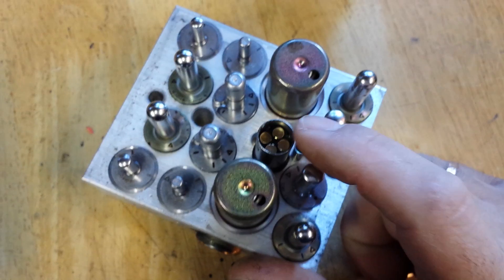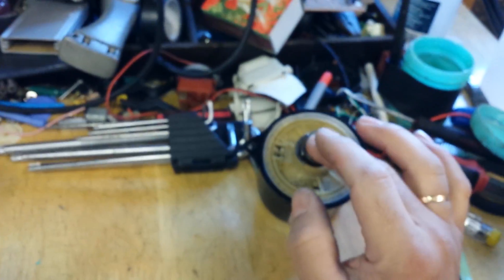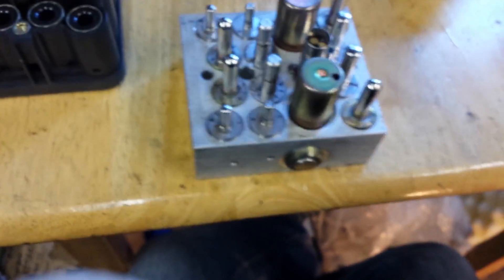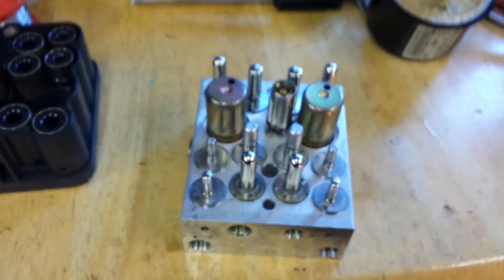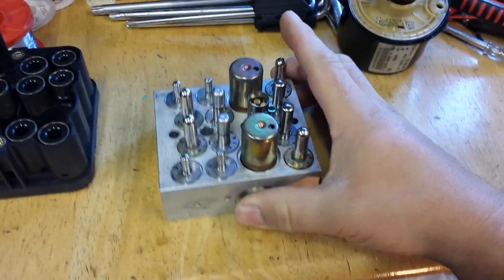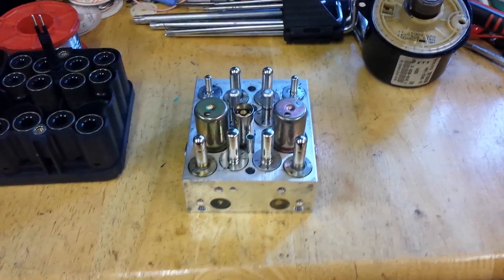Because this sensor is good and that other one is not, I'm going to reuse this hydraulic module and this motor — I'm just going to replace the electronics on top. If you have a brake pressure sensor fault, I'm not sure if you can get the sensor separately from somewhere — you might be able to. I haven't done the research because I have another pump here, so I'm just doing a straight swap of the electronics. Okay, thank you for watching — I hope this is helpful. Any comments, just put them below and I'll be happy to answer.